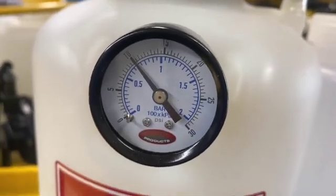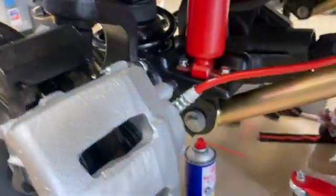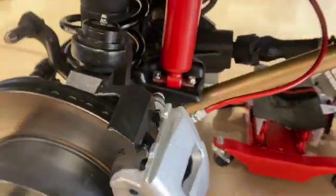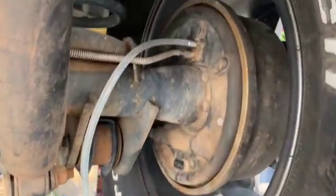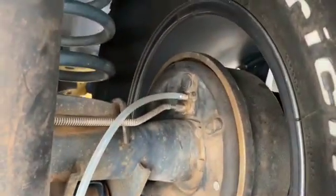All right, so we got about 10 PSI in the jar. You can see there's some fluid in the lines. Nothing's moving though and we've got no leaks at any of the calipers. That's important — you want to make sure nothing's leaking and if it is, you want to address it now. Next thing, like I said, go to the farthest wheel from the reservoir and hook up this overflow tank, and we're just going to crack that valve.